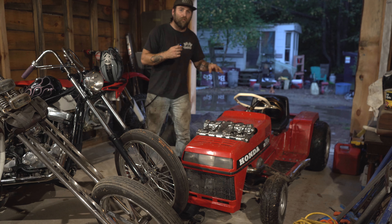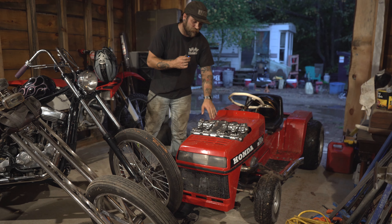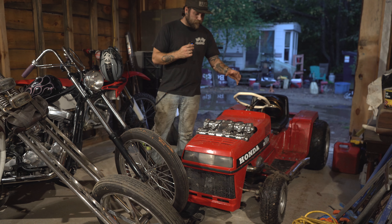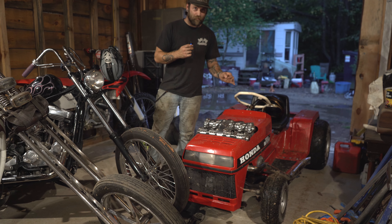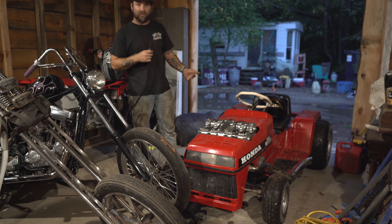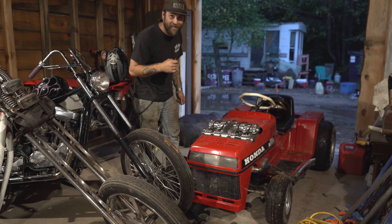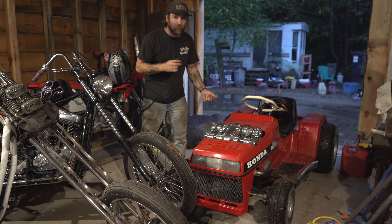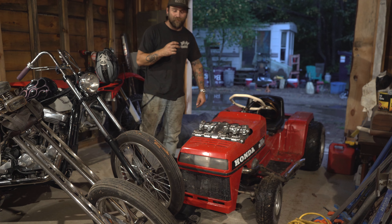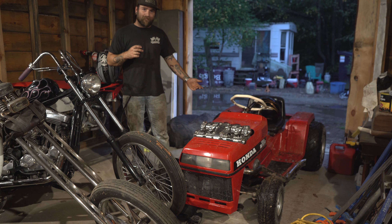Remember in the beginning of the video when I said it was done but it wasn't done? That's the part I'm talking about. It doesn't run perfect, and a lot of that has to do with these CV-style carburetors on the dual overhead cam CB750s — they do not like individual pod filters. I'm planning on building a four-into-one and messing with the jets, needles, and everything in the carburetors to get it dialed in. I'm going to Ohio in November to a buddy's house — he's building his own racing lawnmower and we're going to race. His John Deere with a Harley Davidson Sportster 883 ain't got nothing on my Honda 750.